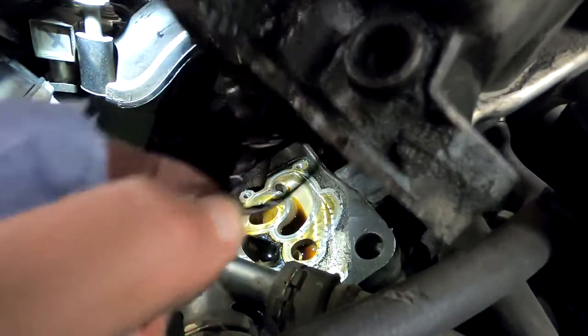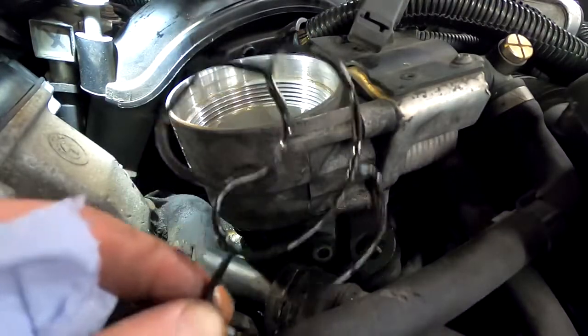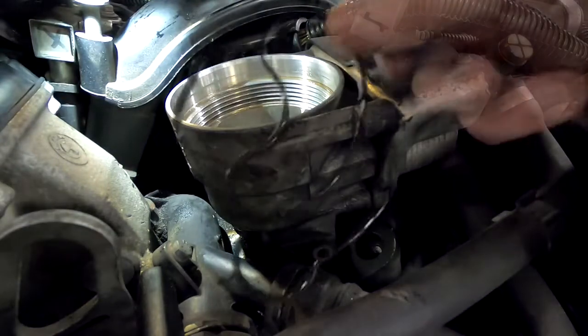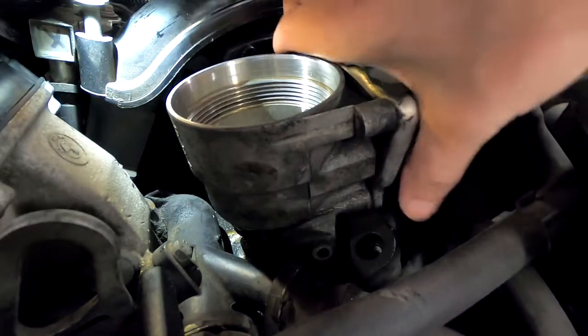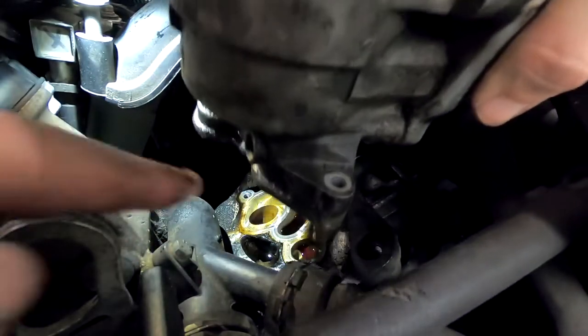So let me clean this up a little bit and we stick in the new seal around here. The seal has a lip right here — see, so you can actually take it out. This seal goes out because it's a bit worn. Old one out, new one in — and if you check, they look almost the same. I will take and clean this off a little bit with brake cleaner and some white rag so the dirt goes away — nothing goes in the engine.